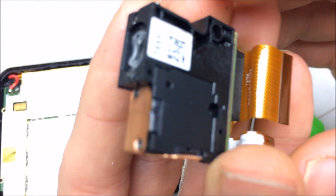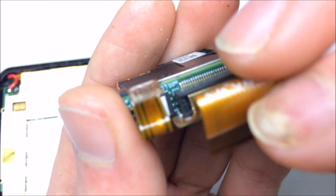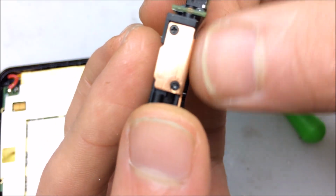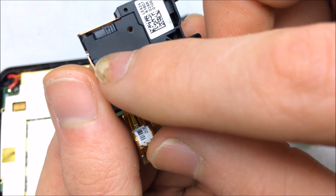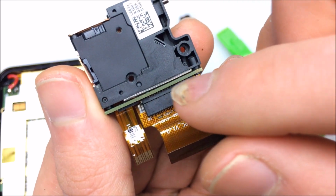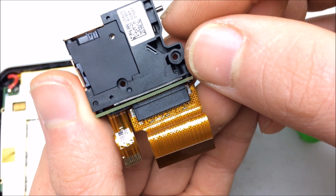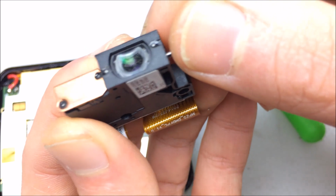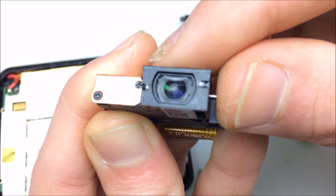So here's the whole optical engine, which will have the DLP chip on the back, so probably right here. LEDs over here on the side, so probably the green LED, red and blue LED, all the dichros for sending the light in, mirror probably here, off to here, another little reflector in there it seems, and the front focus assembly. Wow, that's a very small travel.